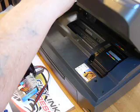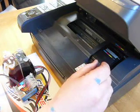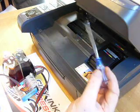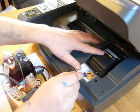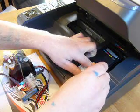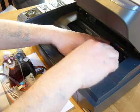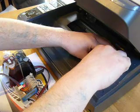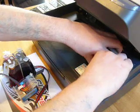I'm going to open the printer lid. One of the first things we need to do is to remove this cartridge cover, so this has to be removed so we can get the ink cartridges and the ink lines in. We have provided a screwdriver in the accessory pack and what we're going to do is remove this clamp here. Put the screwdriver in here — you should be able to see that clamp moving. The tip is to do it very slowly, prising by twisting to the right-hand side and creating pressure to prise the cover off.